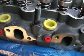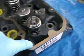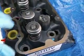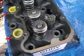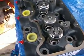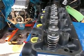When I go to do the bolt hole inside the valve train area, I'm going to be really careful — mask that off and blow it out every couple of seconds as I drill, just to keep the metal shavings out of there. It's a pretty quick process overall. If you have any questions, look me up at leroydiesel.com. Have a good day.